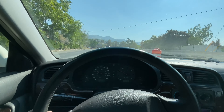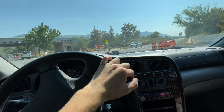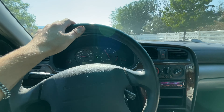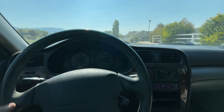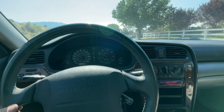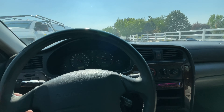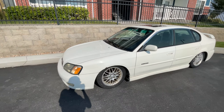The rear is good. The front, we definitely need swifts. There's a little bit of rubbing on turns. The rear might be able to get away without swifts, but we'll have to see how good the fitment is when we put the new wheels on. If we have good fitment, we don't need swifts in the rear. If we have bad fitment and need to lower it more, then we need swifts. The rears are maxed out as possible without switching spring height — if I get 4-inch 28K springs, I can go down another couple inches in the rear and still not rub. I could drive totally fine like this.